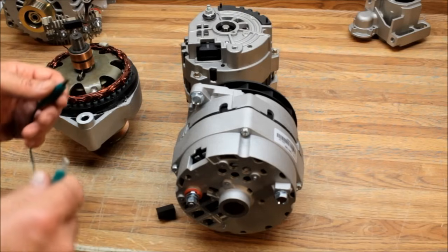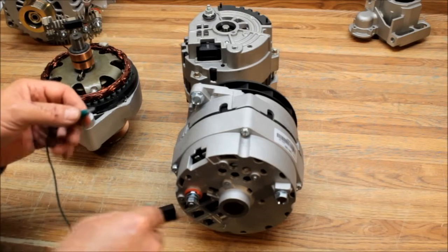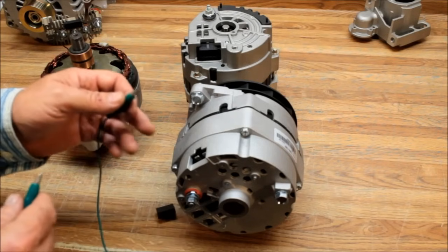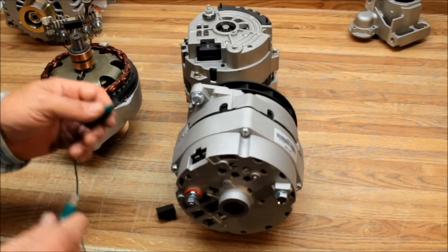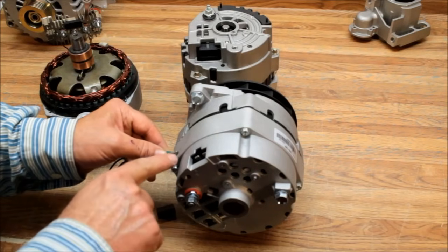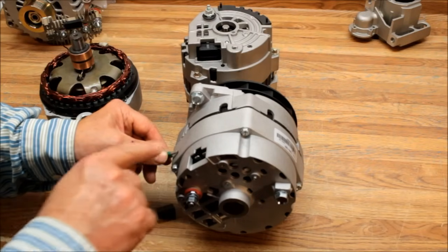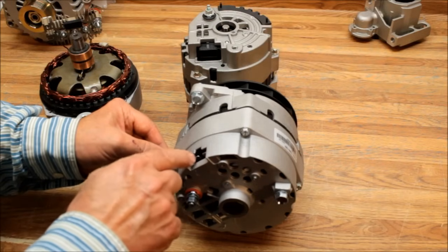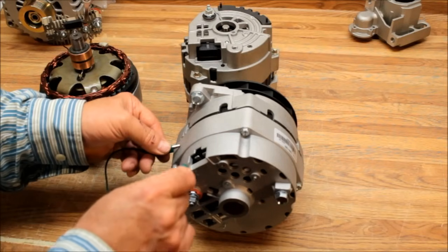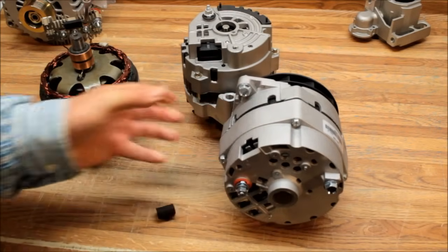A lot of people are converting generators to six-volt alternators. Negative-ground six-volt units excite the same way from the battery post and number one terminal. With positive-ground six-volt setups everything is reversed, but the voltage regulators are still negative-ground internally. To excite a positive-ground 10SI, run a jumper from the case to the number one terminal — in positive ground, negative goes to the battery post and positive goes to the case, so you still apply positive to that terminal.